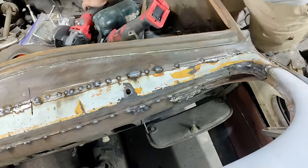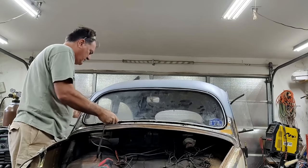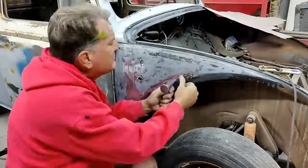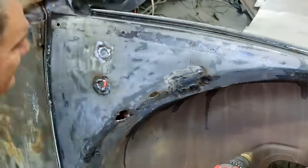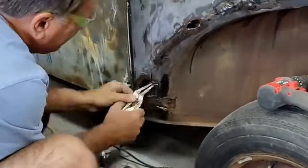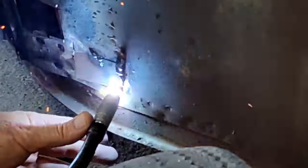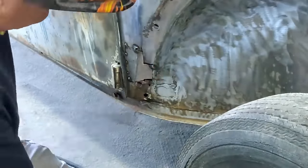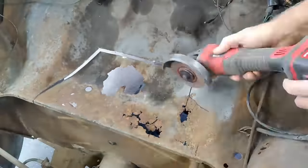This was a decent-size repair — actually not hard to do, just lay one piece over the other and get a pattern going. These had the same issue as the back — really thin areas along the edge where the fender was, I guess because it was raw metal for a long time. The bottoms of the fenders are almost always bad in this area, but the funny thing is the heater channels weren't really that bad overall.